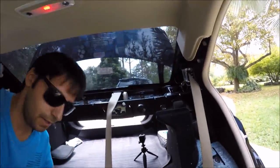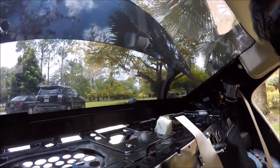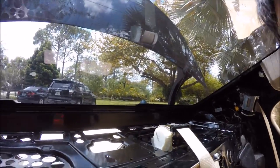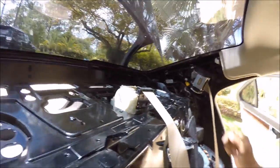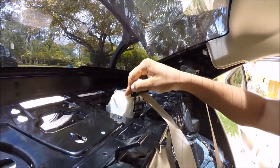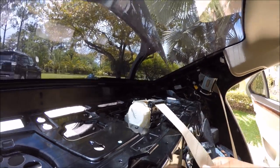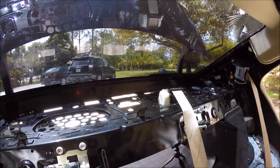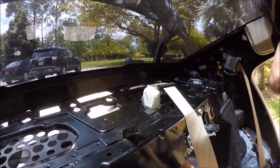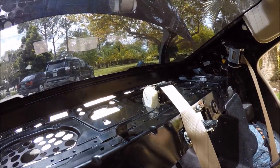What's causing that noise is when you're back here inside the car and you're driving, and it's a nice quiet day, you hear the birds chirping, and then suddenly you hit a bump and you hear this. That rattle noise is happening from the center seatbelt bearing, right here. The seatbelt still works — see, it still works perfectly. The last thing I want is to put a sound system inside this car and every single time the bass hits, I get that. That is very frustrating.